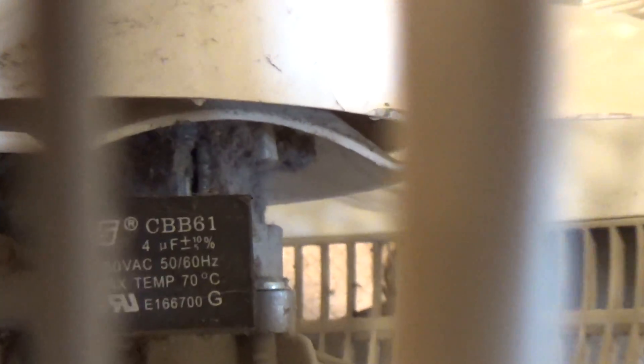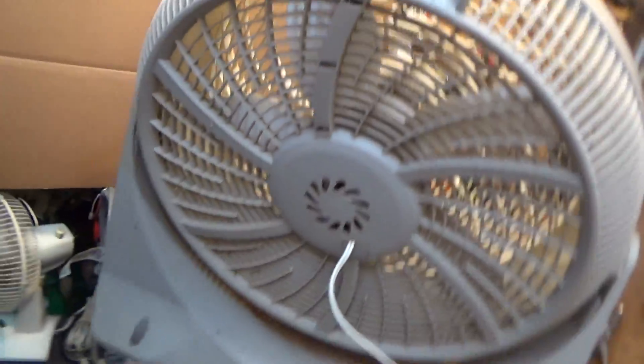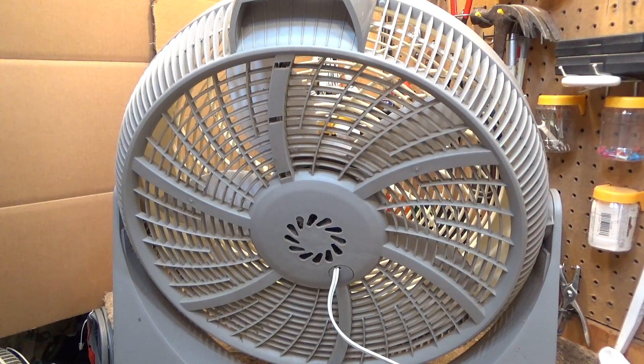As you can see here, this motor is doing absolutely no cooling. It is completely blocked up with dust - fully blocked. And you can look and see on the side here, all that dust blocking all the vents on the motor. So I suspect the motor lost all airflow through it and overheated at some point.